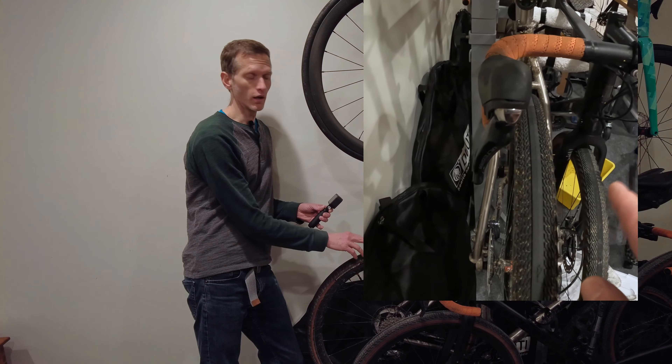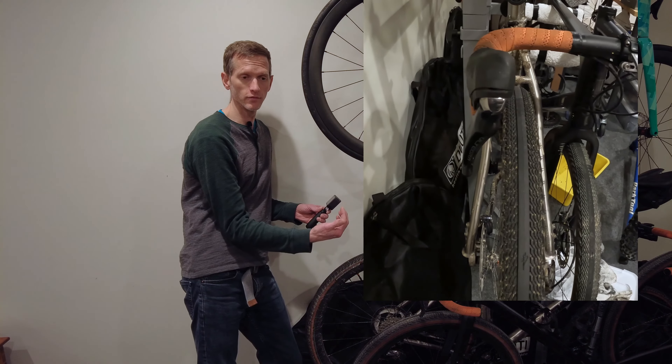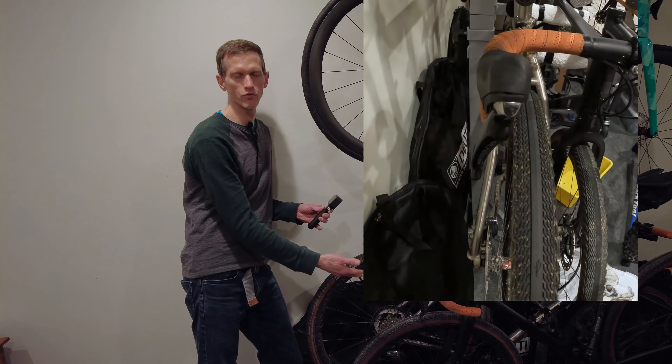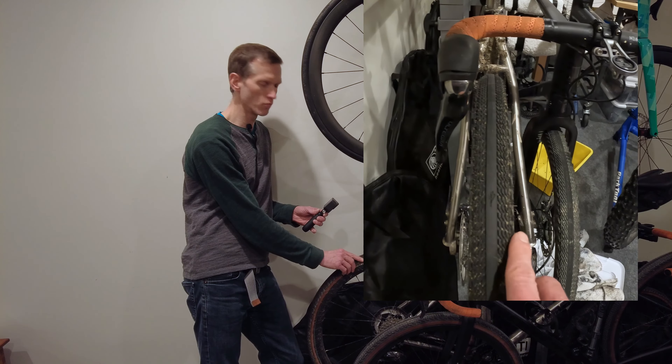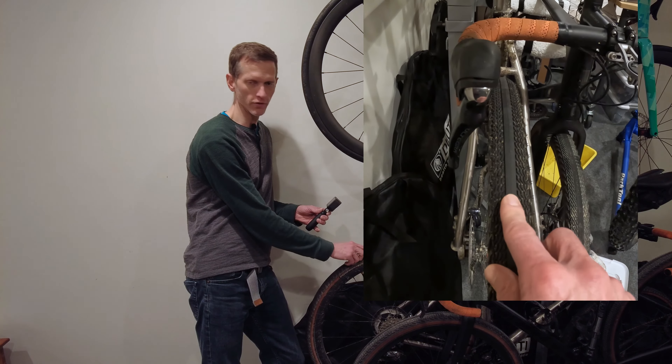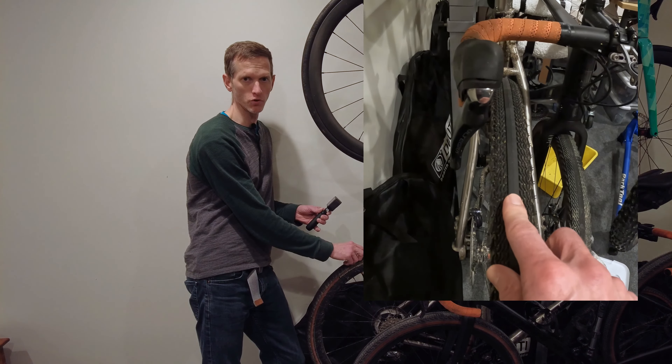The issue with these tires is that if you set them up for dry and you get into a situation where you're running on something slippery on the surface but hard underneath — like it just started to rain or there's a little bit of water over rock — the contact patch is minimal and it's pretty easy to wipe the bike out. I actually did that riding in drizzle: it was dry and transitioned into drizzle and I wasn't paying attention, and I ended up taking some chunks out of my leg. The way to mitigate that is by letting air out of the tire to flatten the profile so the lugs engage and the contact patch is wider and more patterned.